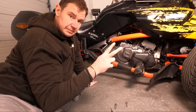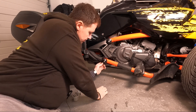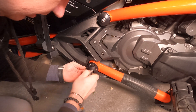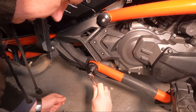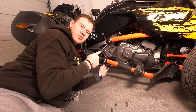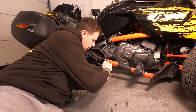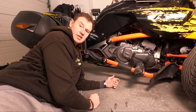For the bottom frame cap, my advice is to put a hand in here because this frame has a tendency to go a little bit down. You might put the screw in at an angle rather than straight — you don't want to do that. So put a little bit of finger pressure here, tighten it, and then you're all good to go.